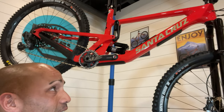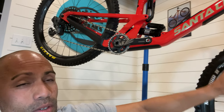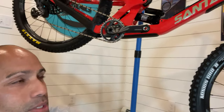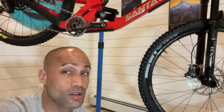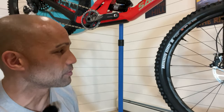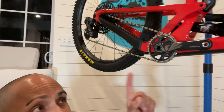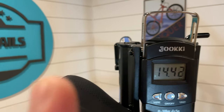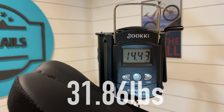As for the geometry of the new 5010, it hasn't changed much. I'll give you an average between the high and low chip positions. About a 65-degree head tube angle, about a 77-degree seat tube angle. You can check Santa Cruz's website — I'll leave that in the description. Reach on the size large is 476 millimeters. Top tube length is about 625 millimeters on the size large — similar numbers to the old 5010, just with the mixed wheel. They do have size-specific chainstays, so as the frame grows the chainstay length grows too, which is pretty cool for keeping geometry consistent between sizes. As for weight, it's bouncing between about 14.4 or 14.5 kilograms — I'll put the conversion on screen.